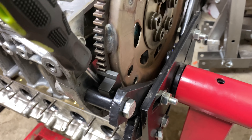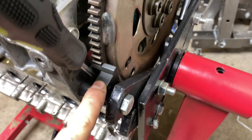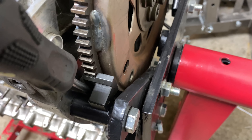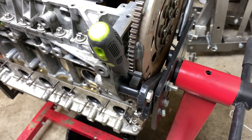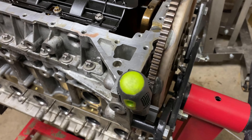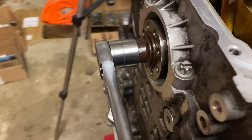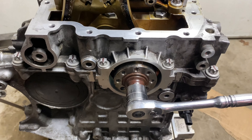It works great, however there isn't anything here that would work for the engine-out situation. So I decided to just jam it in there, up against the flywheel, and get a screwdriver to keep it in place — it's pretty solid, it's not going to go anywhere. Now I can go ahead and do my 100 Nm plus 270-degree torquing on the main bolt. Should be interesting.